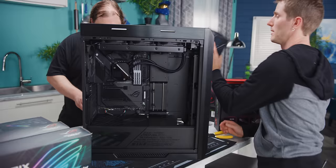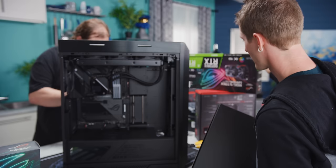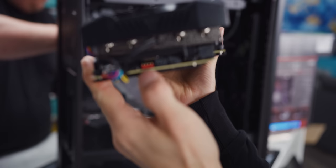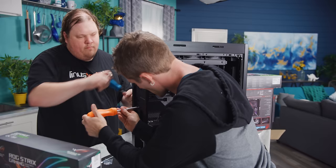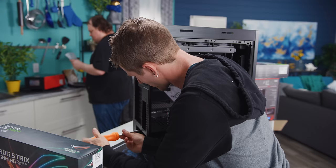Power supply for Anthony — we're throwing in our ROG Thor 1200-watt Platinum, which appears to be the entire reason there's a window built into the bottom of the case, because this power supply has a display on it. And I've got the glamorous parts for myself: dual RTX 2080 Tis in SLI. This case has a feature that lets you put one graphics card in a show-off vertical position, but with hard SLI bridges, it's not possible to run SLI with one card in that position.